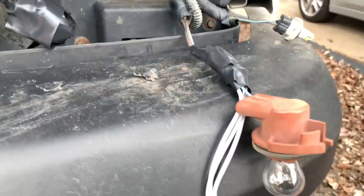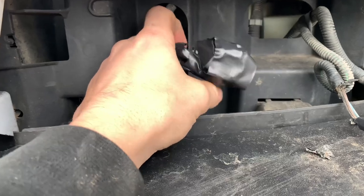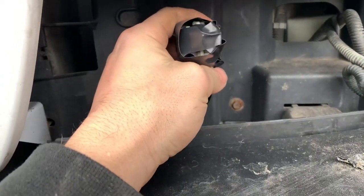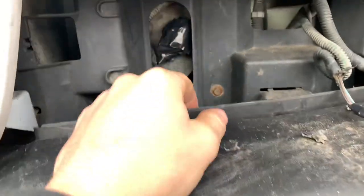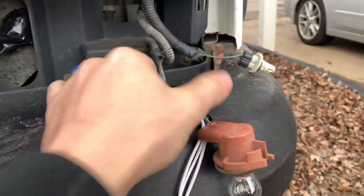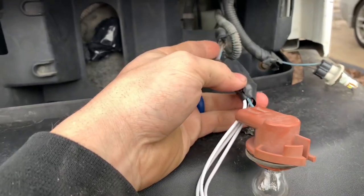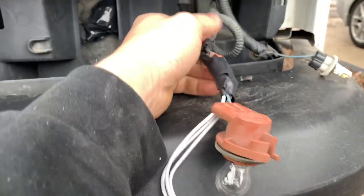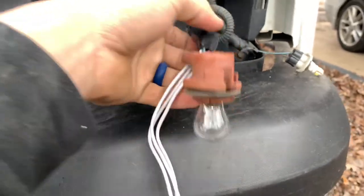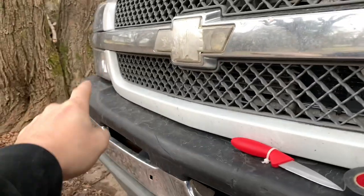Real quick, I just want to show you how I did this. I completely wrapped the old plug in electrical tape — I'm sure there's a better way to do this, but I don't think there's really going to be anything getting in there, so I'm just gonna tuck this up in there. It'll probably fall but it's out of the way. For the splice, I've got all separate wires electrical-taped individually and then wrapped electrical tape around the whole bundle to try to keep moisture out, and bring the loom up as close as you can to it.